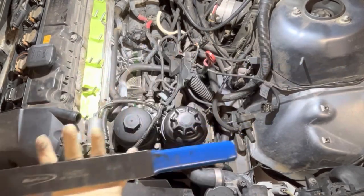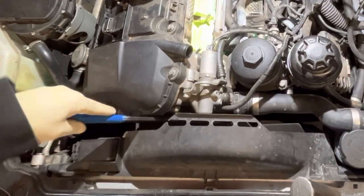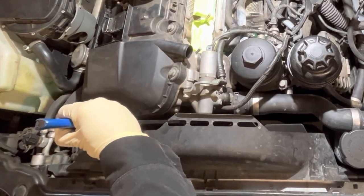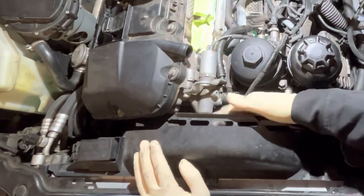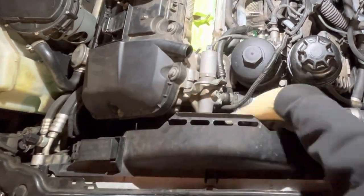This is the fan clutch wrench. I think it's like a 36 millimeter wrench. Use this in conjunction with a hammer to hit the nut on the cooling fan in a counterclockwise direction. This engine's serpentine belt spins in a clockwise direction if you're looking at the front bumper, so knock that in the opposite way, spin it off by hand, and you'll be able to have a lot more room to work